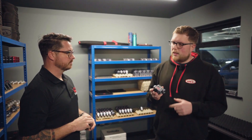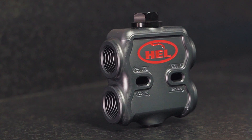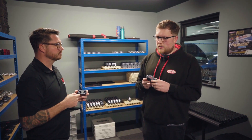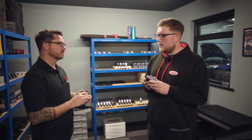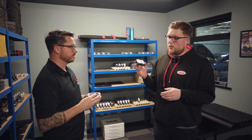This is one of our newest products. It's our inline oil cooler thermostat — this is actually version two, and we're really excited about this product. You would need a sandwich plate for basically an oil cooler to run that inline. So for anyone that's running an oil filter takeoff plate or a non-thermostatic sandwich plate like this one, you would run this one in line between that point and an oil cooler.